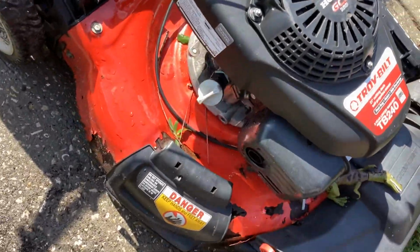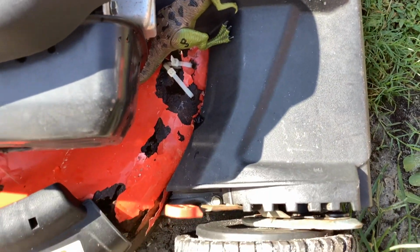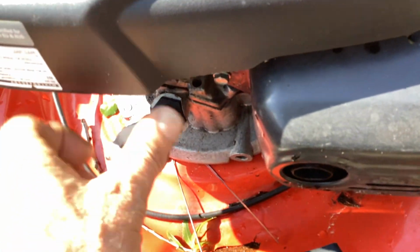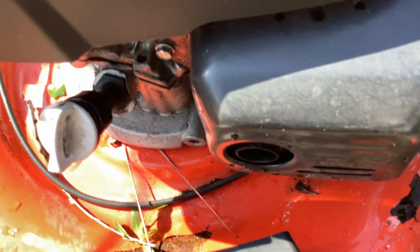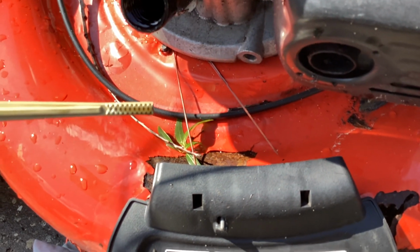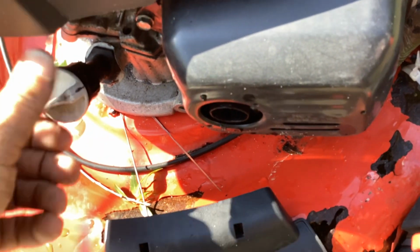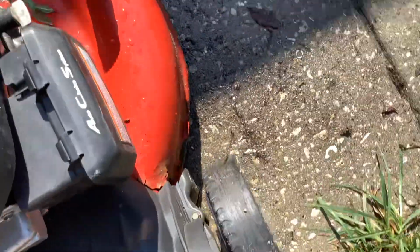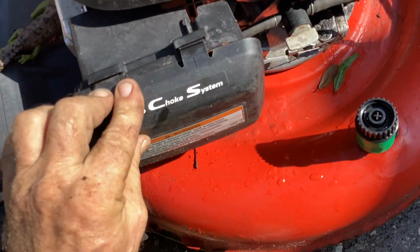Check oil. So this thing might have a running engine and they just got concerned with the zippy ties breaking and causing damage. So on these Hondas, wipe your dipstick and just let it sit there on the threads. Don't screw it in. Then take your reading. So we got enough to try to start it. I mean, it doesn't look overly used. The 2017, we could use the transmission, all the plastics, air filter.